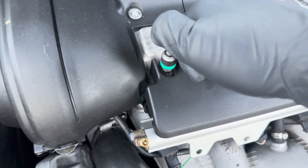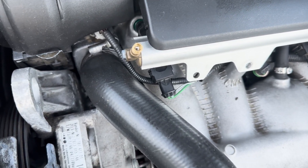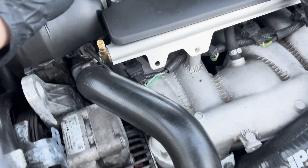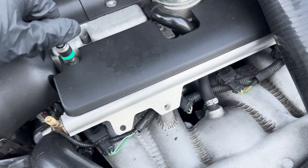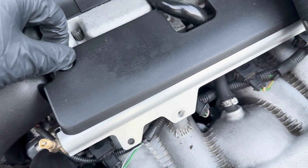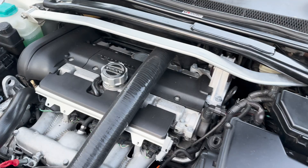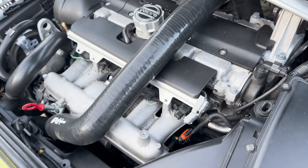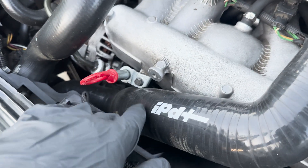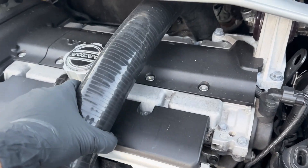On my car I'm a bit lucky because I'm using the IPD boost charge pipe, so I have a bit of wiggle room when it comes to the second bolt. On your car, if it's stock, it'll most likely have a plastic or magnesium charge pipe and you'll have to remove it. I'll show you where your bolts will be - it's right under the charge pipe. You can disconnect it down there by the intercooler and over by the turbocharger.